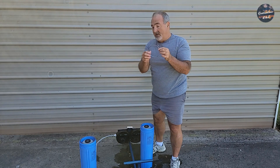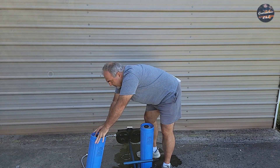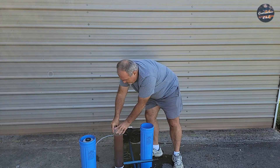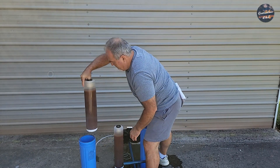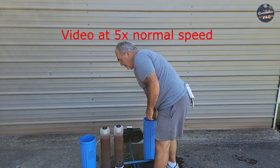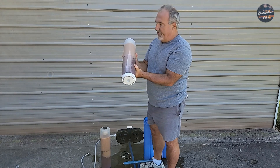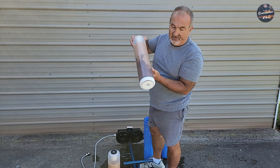Make sure you lay these aside — do not lose them, you will need them to reinstall your canisters. Simply stick your thumb in the center and lift up on the canister. At that point your remaining water you can empty. Even here you can still see that there's water in the resin, so you still have to get that out if you want to refill these. You can drain it like this, or you can turn it upside down, take the cap off, and just pour it out in a trash bag. You can set these out in the sun and it will drain out over time.